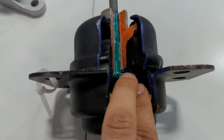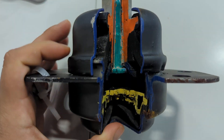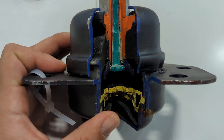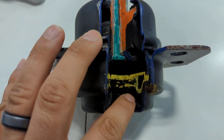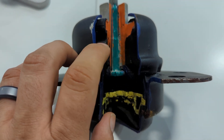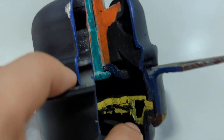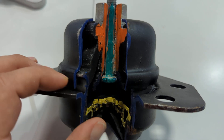When the fluid leaks, all you have is this rubber piece that's left, and that will actually move further down. It still minimizes vibrations but not anywhere close to when the mount is good. That's why, for example, on a Mercedes or BMW with hydraulic engine mounts, you feel those vibrations in the cabin and steering wheel — because the mount has leaked all the fluid out. This works a little bit but not quite as well.